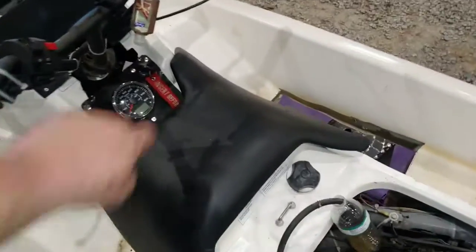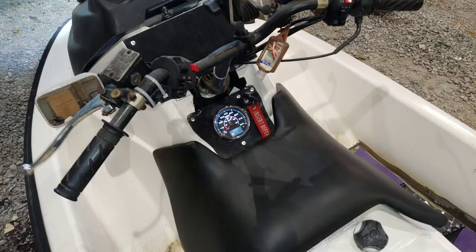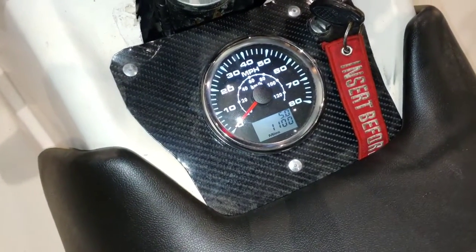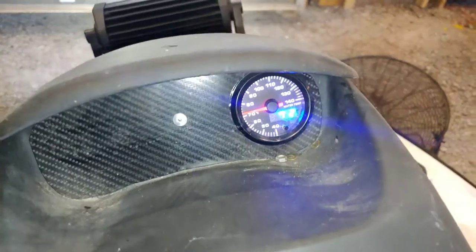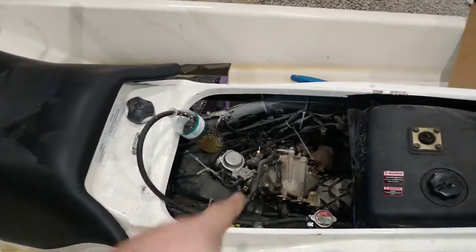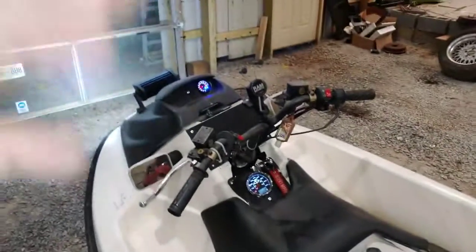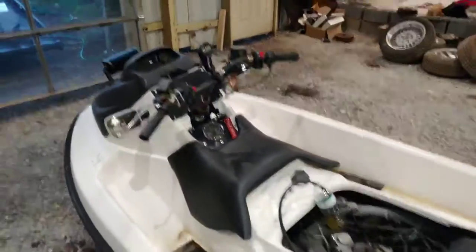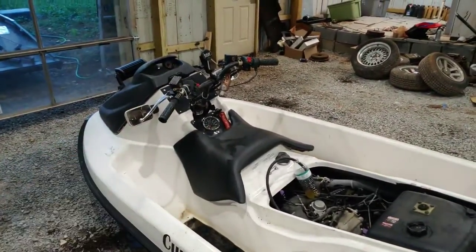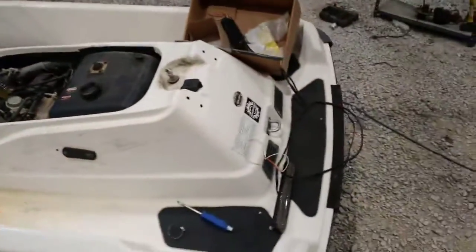Running great. And there's my gauges. Since I've had the bike together, I've put 1,100 miles on it, exactly. I changed out the temperature gauge — there was a little temperature switch right there. That was connected to the temperature gauge. It wasn't working properly because I had the scooter sensor on there — they weren't playing together — so I replaced that. While I had this apart, I went ahead and changed that sensor, and it's been good so far.